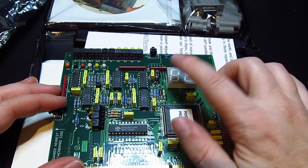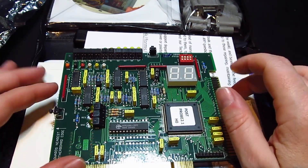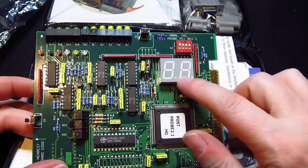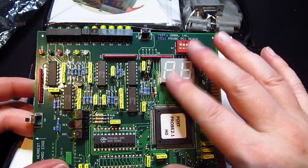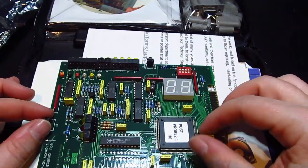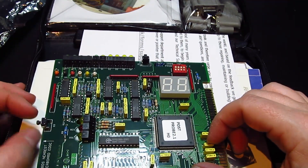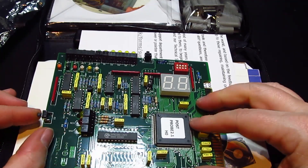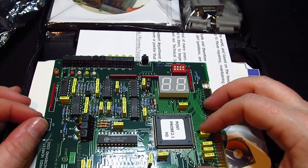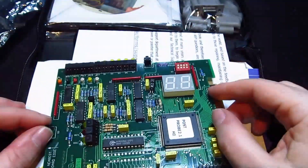It does show the A0, B1, 1, 1, 2, 3 codes for the BIOS. Years ago, your computer manual came with a BIOS message number error list, and that would tell you what it is — and the same with this manual. That's how we used to diagnose PCs way back at the turn of the century, when I was a support technician and an IT manager, just as plug and play was finally taking a foothold. Before that, we'd have had to take all the jumpers off and configure ports and things, which wasn't fun.